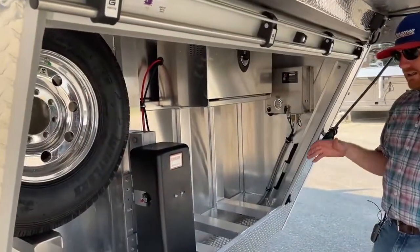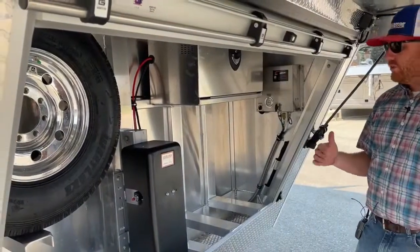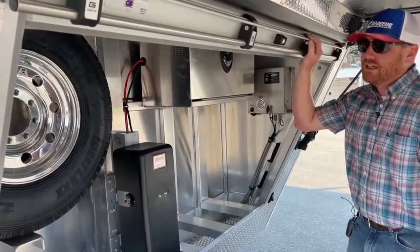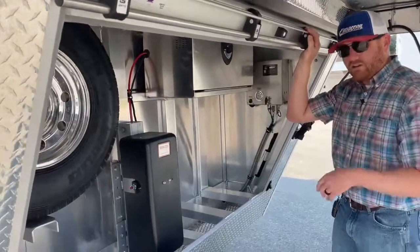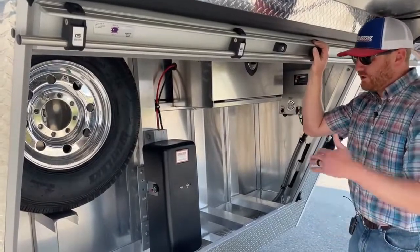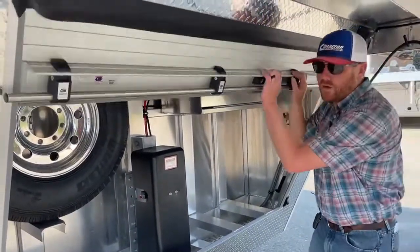On the air ride, I always tell customers to load your tack and load your animals when it's in the lower position. The reason why is it will actually raise this trailer two and a half inches. So when it raises it, we get more angle on the ramps itself making them a little bit steeper, and then also bigger steps getting into the trailer. So load all that equipment, load all your animals, and then put it in the raised position to go down the line.